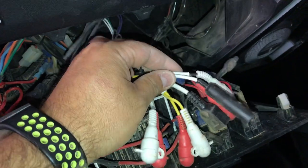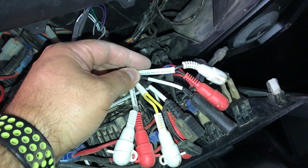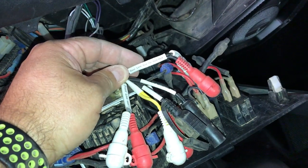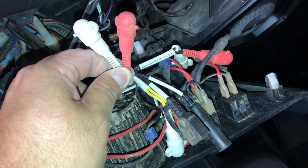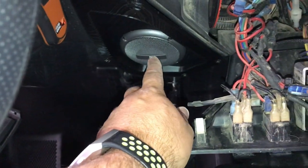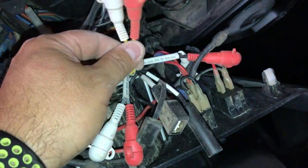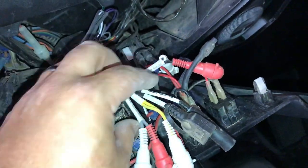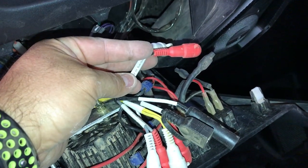You need to identify these wires. Right here you've got the rear line out or sub out. Since we're doing rear speakers, this is for the rear line or the sub, so I'm going to use this one to go into the amp. These are for front speakers if you wanted to go that route — I'm not hooking the smaller speakers up to the amp because they don't need it; it'll be too much amperage. And then here's an AUX out as well, and the antenna and all that stuff which I don't use. That's what we'll be plugging into to hook the amp up.